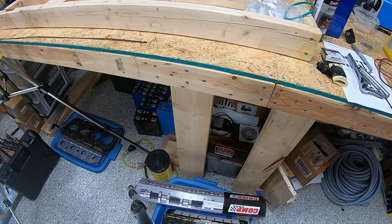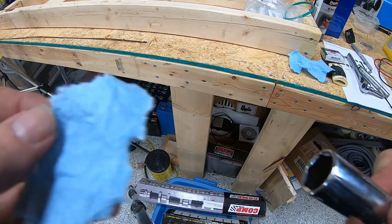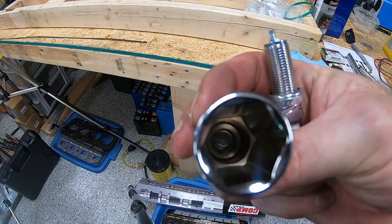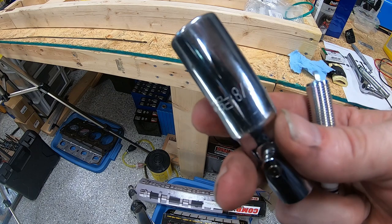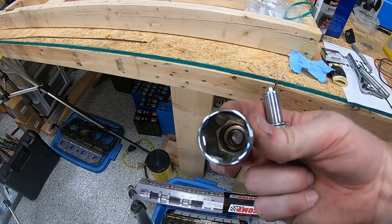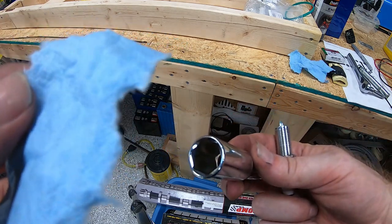And welcome back. So we're down to our last spark plug on our driver's side to install, and I figured I might show you this. You've probably seen this trick before, but what I was referring to earlier, a little bit of blue shop towel. There's our spark plug socket. If you remember, we took the little rubber insulator out of it, because it was getting stuck to the plug, and in those deep wells, we couldn't get our spark plug socket out.